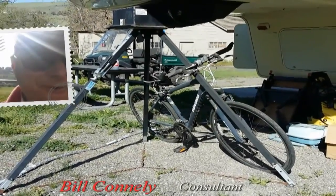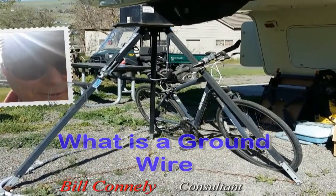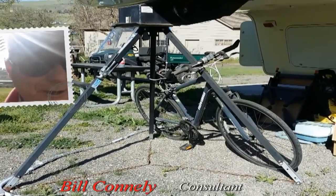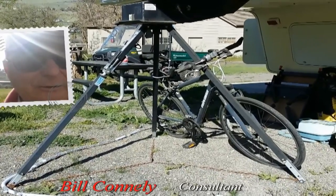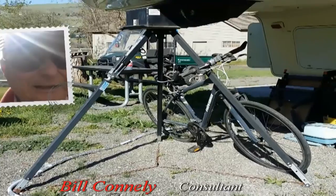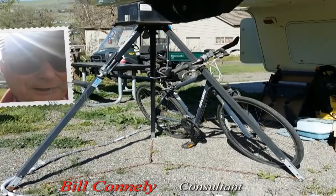What is a ground wire, especially for an RV? Well, here's the situation: most of us park our RV, put blocks under the wheels, blocks under the stabilizers. If you have a fifth wheel, you put blocks underneath where the legs come down. An unfortunate part about that is your trailer isn't grounded to the ground anymore. I have a stabilizer on the front of this that kind of pokes into the ground a little bit, and that's my ground.